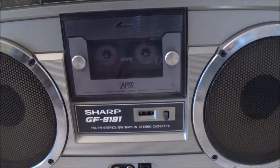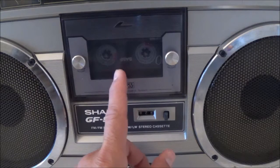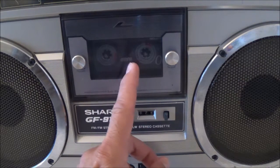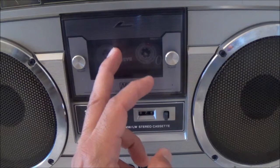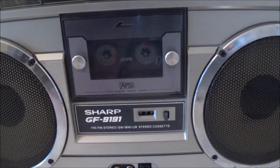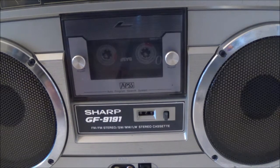Because if it's been used a lot, the pinch roller can be worn. You gotta make sure the head doesn't have too many scratches — you can see scratches with your naked eye, or if you run your finger across it you could feel the deeper grooves. A lot of times it's just a heavy buildup of oxidation on the head, the pinch roller, and the capstan, which has to be cleaned.